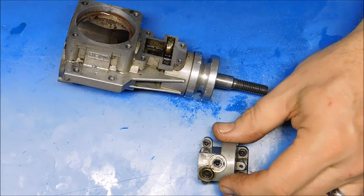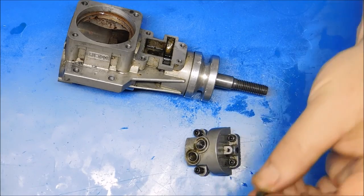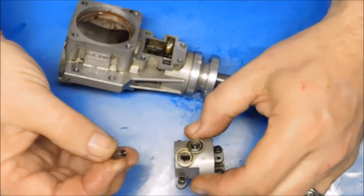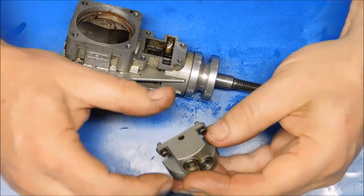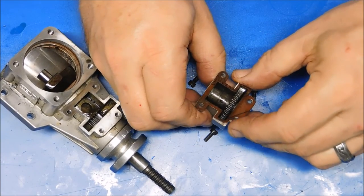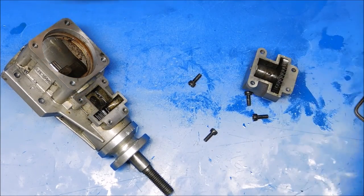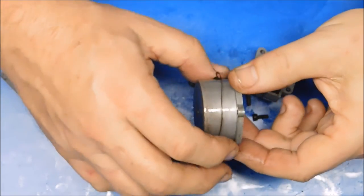The thing I just thought of that's cool is that on my 120S, the tappets, the cam followers, were flanged here so that they could go in only this way. This one, since it came straight out, obviously that isn't the case, so I'll be able to use my timing tool to set the timing on this engine. Let's see if this gasket is going to survive. Yep, gasket's in wonderful shape. That reminds me, I need to take the one off of this before going in the cleaner.